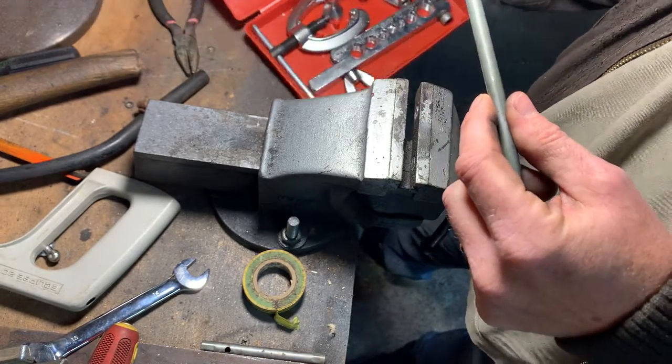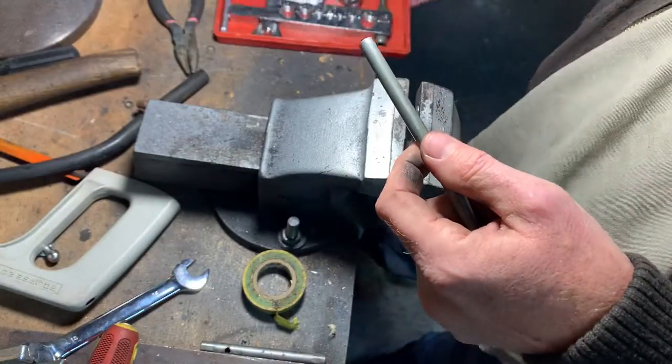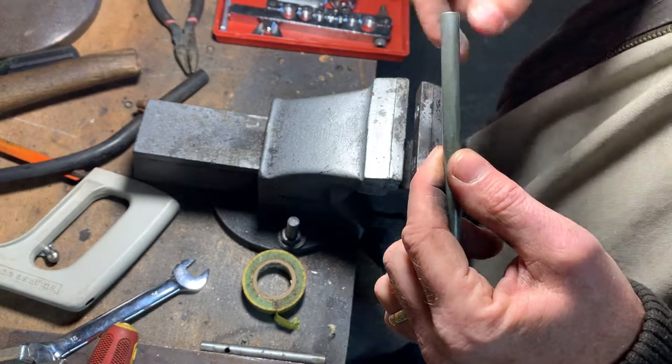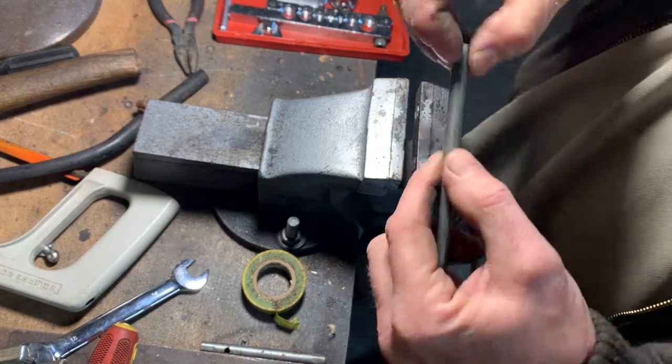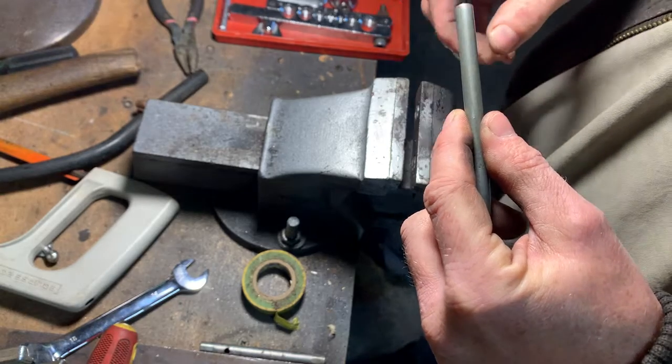You can buy kits where you can make flares of all sorts of different sizes, but with steel line like this I've found that just doesn't work. It either deforms the pipe or it just pushes it through. The grip can't get a good purchase on the hard line.